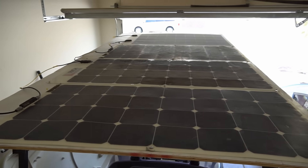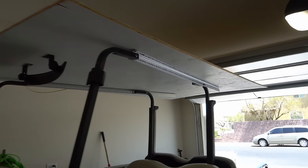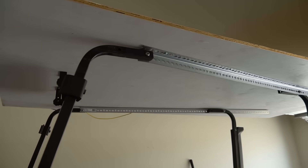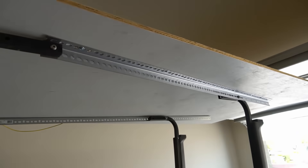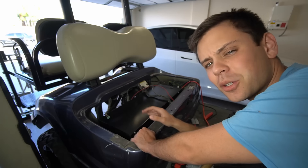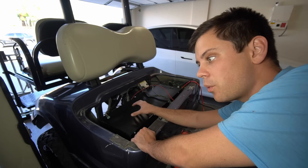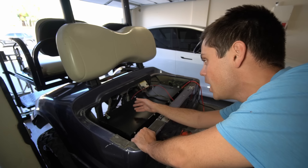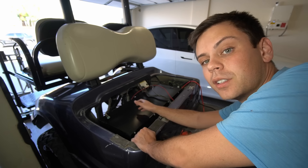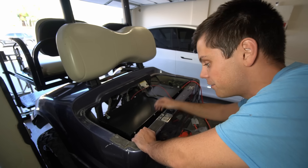The solar panels are now mounted — I screwed them in and connected them in series. I know this is not the most sophisticated way of mounting solar panels, but it's great for my use case. I just want to see how much power these will produce. If it takes a week for this battery to charge, I'm going to rip this whole thing off and add a plastic roof instead. A few hours ago, we got the lithium iron phosphate battery from bigbattery.com — I'm sponsored by them and I'm testing their golf cart conversion kit. But if this doesn't work to my liking, I'll build my own lithium iron phosphate battery. So we're going to hook this up with the main negative and main positive and see if it works.